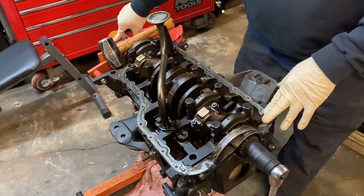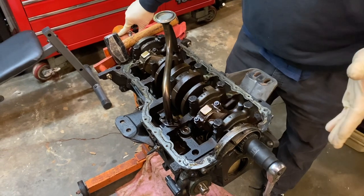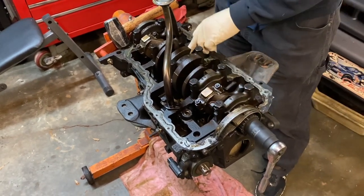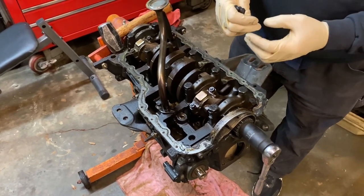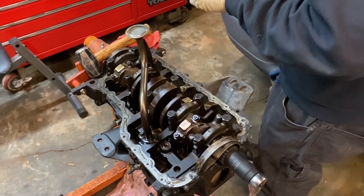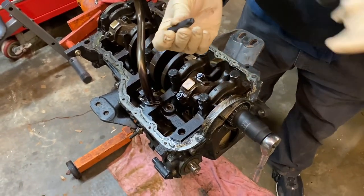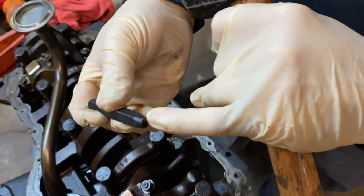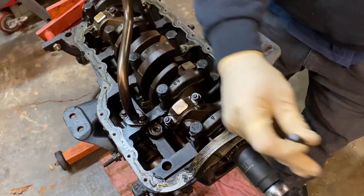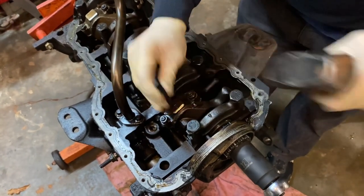With the engine flipped upside down, we're going to go ahead and mark all four of our connecting rods here. If you had a six-cylinder or a V8, it would be the same thing — you'd just be marking six or eight instead of four. From the front of the engine, number one's always closest to the front, so it's one, two, three, and four. My stamps here are one, two, three, and four, and I also have a V, because I'm going to use it as an arrow. I'm going to take the V and mark all these caps in such a fashion so the point of the V — like an arrow — indicates the front of the connecting rod cap when it's bolted in place, pointing toward the front of the engine.